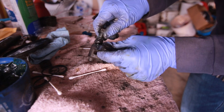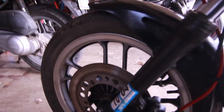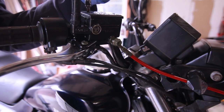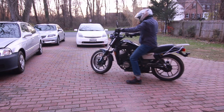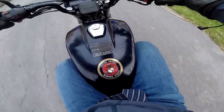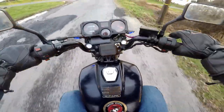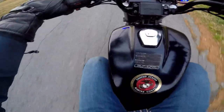Grease that — it actually fits pretty well. Put this bolt in here and make sure you lube it. Now I just have to attach this cable to the brake caliper. Brake caliper is in. Now I'm going to bleed the system — making sure there are no bubbles coming out. It's a bit of a pain to get it all out. Going up and down the road — it seems to stop, brakes are not great but it does stop. Now it's moving and it brakes — alright, we got brakes!